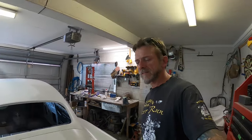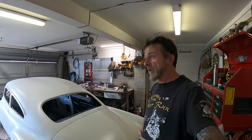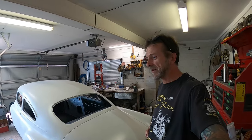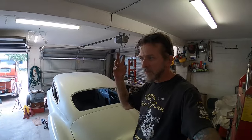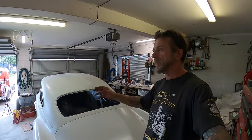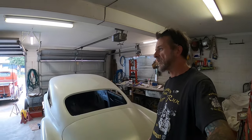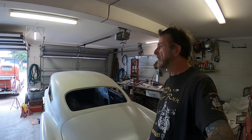The rest of the gun, I actually remember being quite meticulous about how well I cleaned it out, and I was quite proud of myself until this moment where I discovered there was a little dried plug of paint starving my spray gun of air. So the only air it was getting was what it could suck in from around the cap, to replace the paint that was coming out. So it felt like it was starving a bit. I opened up the fluid feed a bit and it helped minimally.